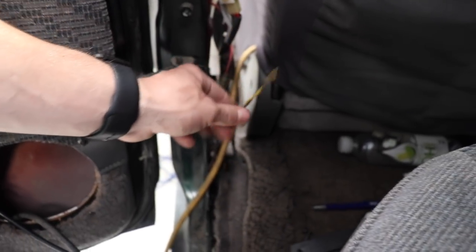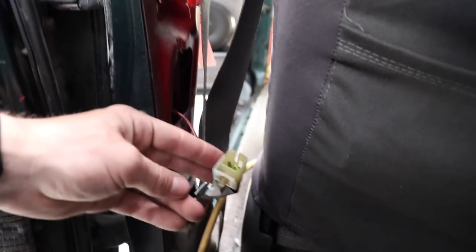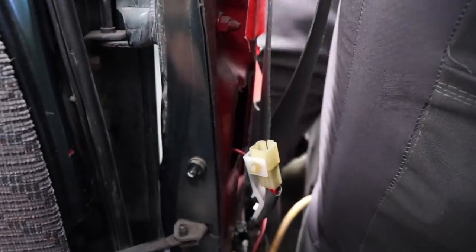Got some of the wiring done. First of all, I found in the loom down here the wiring for the factory rear left speaker, which is in the boot. So that's going to run up to here, and it's going up to the connection for the rear left door, which you'll see I have actually disconnected and pulled back through. So there's the grommets and everything. And then I've got myself a piece of that shielded cable I was talking about before, loomed up with the factory loom. It's going to pop out there, and the connection is going to happen right in there.